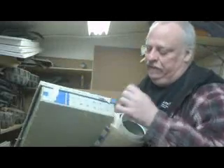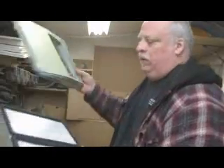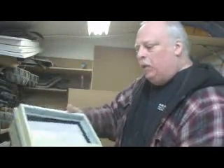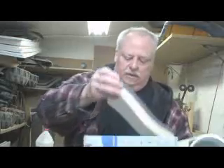Now the top of this — I can take this off. I taped these together temporarily so that it wouldn't warp from the glue. This top piece will be attached to the scoop. I used two air filters instead of one — the air directly goes through one, but there is a one-inch gap slot for the second one, because more surface area has got to be better for air flow. That whole top is going to bolt down — I have four bolts to bolt it down — and then you take it off and you can change the filters.